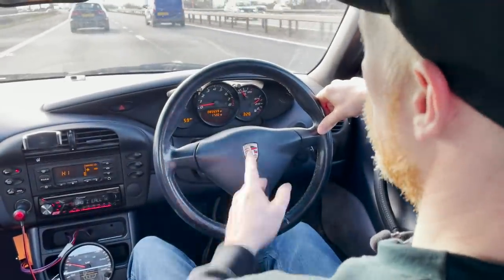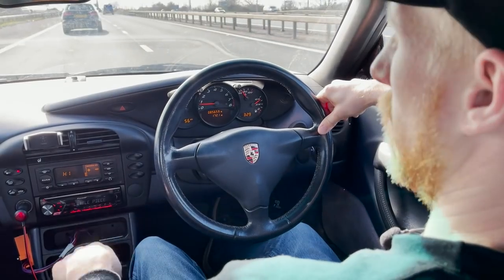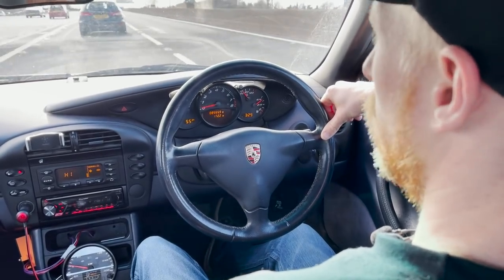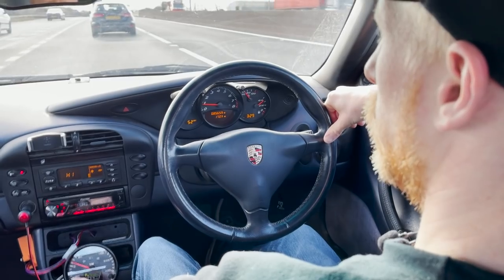For those who haven't watched the Boxster build previously — it was done about a year and a half ago and was one of the first builds we did on YouTube. It's running a Tesla small drive unit and a 36 kilowatt-hour Tesla B-class pack, though it was a high-mileage pack so it's actually more like 27 kilowatt-hours. It has a liquid-cooled battery using the original Porsche radiators, two coolant loops — one for the motor, one for the batteries. All the original Porsche dials work: amps, speed, fuel and temperature. There's also a new 911-style gauge showing kilowatts, range, watt-hours per mile, gear, and sport or eco mode.